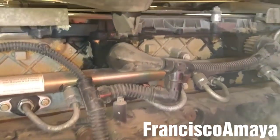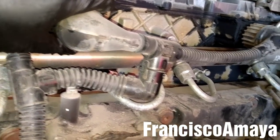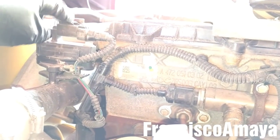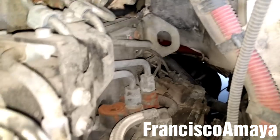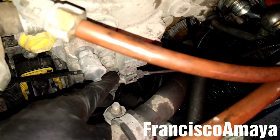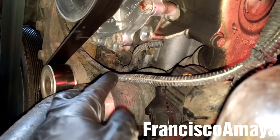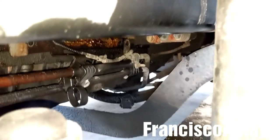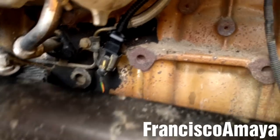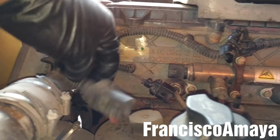The square plug goes inside here. After removing all the bolts from the harness, I'm going to start by disconnecting all the plugs, starting with the injector plugs, EGR Delta Pressure Sensor, Fuel Pressure Rail, Doser Block plug, Cam Position Sensor, Water in Fuel Sensor, Oil Pressure, Oil Temperature, Coolant Temperature Sensor, Crankshaft Position Sensor, and the EGR actuator.